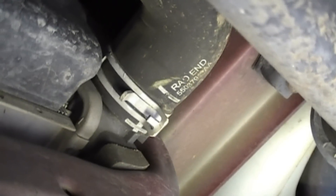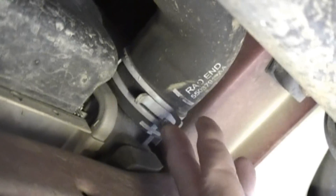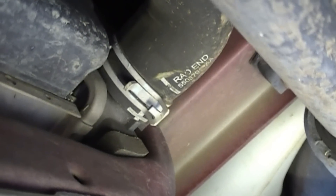The first step among many: we've got to get the coolant out. So the first step is to take this clamp off of the lower radiator hose so the coolant can drain out. It's a very messy step, and I'll try to put enough down here to capture most of the coolant.